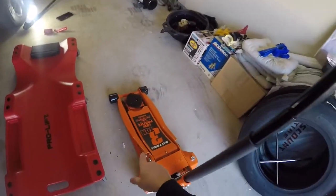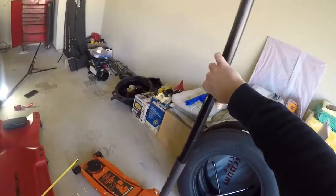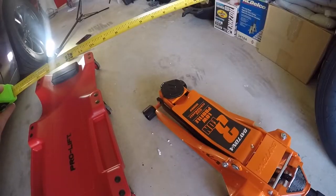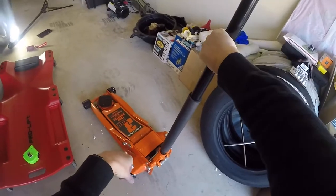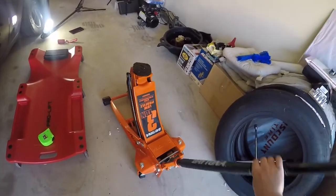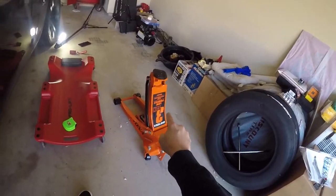There's a little block right here. It goes straight up at a 90-degree angle, and one pump — that's a pretty good amount. Let me grab a measuring tape. We're going to see how much that goes up with one single pump. As of right now it is about 3¼ inches. Let's give it one single pump — we went from 3¼ inches to about 6½. So 3¼ inches with each individual pump. How many pumps to get this all the way up? 1, 2, 3, 4, 5, 6 — it's actually less than 7 full pumps to get the jack all the way up.